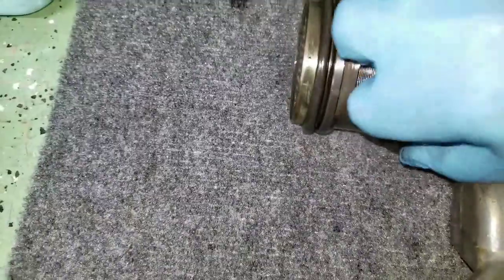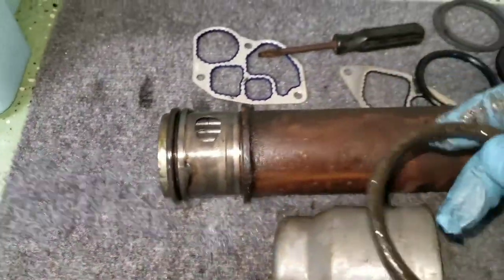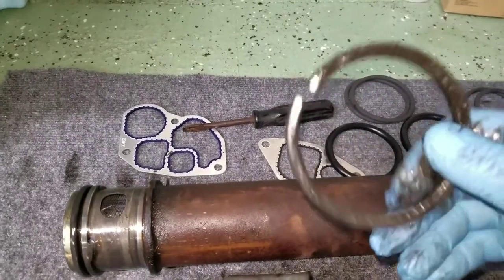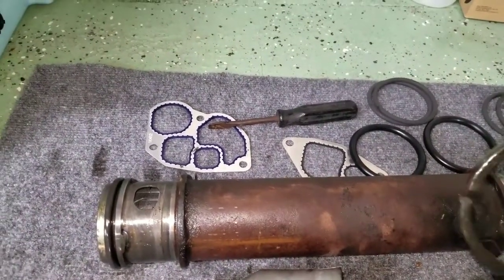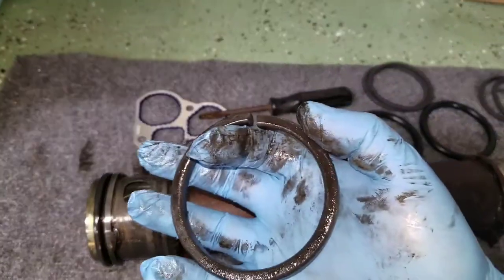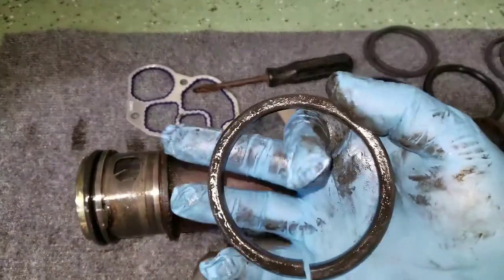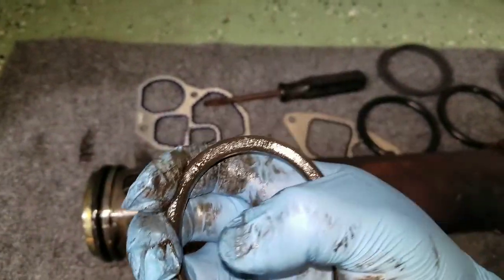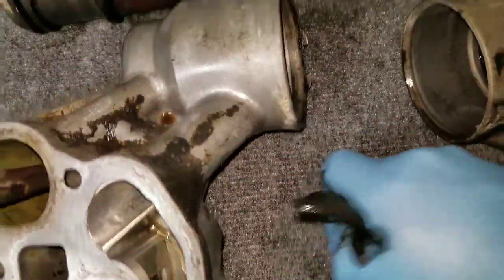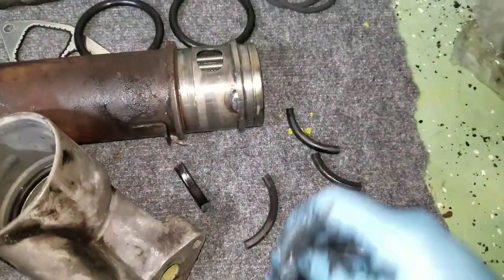See that? So if you do have a leak and it's very difficult to locate — I had a problem because the way it was leaking, it was dripping off the front and dripping on my fuel lines. I stuck my hand in there, cleaned everything off, and it took me days before I could find it. But if you have a leak that's hard to detect and it's anywhere around this oil cooler, it's definitely this. Watch this — there you go, there it is. There's my O-ring, there's my problem.